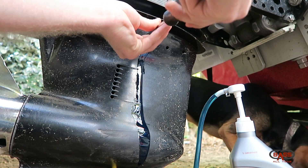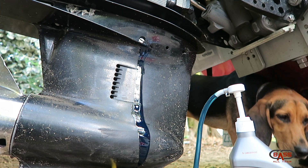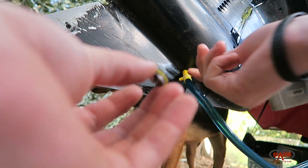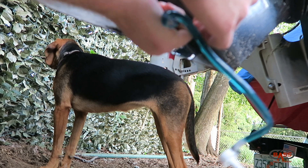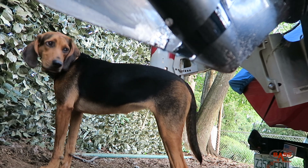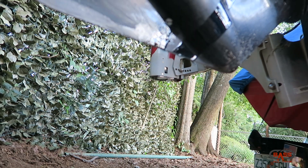Once it's overflowing, put the top screw on and tighten it down - you don't need to impact it on there, it'll be pretty tight with the gasket. I always bring the motor back up a little bit because the bottom screw is so low in the lower unit it's hard to get an angle, and you're fighting gravity. Work slowly so it just barely starts coming out, then get that bottom screw in, grab your screwdriver, and make sure it's tight. Clean up any oil that ran down the lower unit.